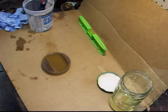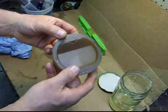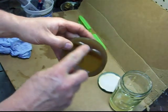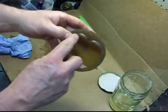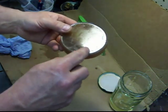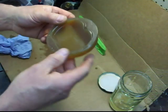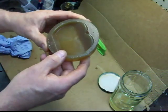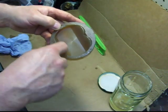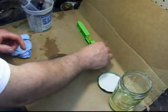The next thing is I have a mold from an aftermarket piston and we're going to compare that one. Now this is the aftermarket piston dome and you can see it has very deep cut valve reliefs. What you have to do is take the piston, put water in those valve reliefs, and add that volume to this measurement to get an accurate total. I've done that prior to this, so we're not going to do that now — we just want to see how much this holds compared to the other one.